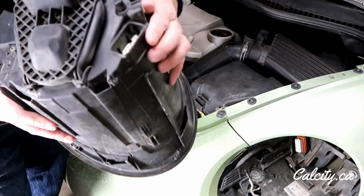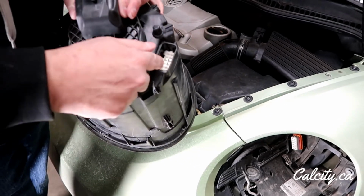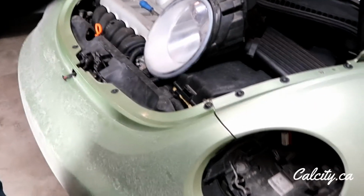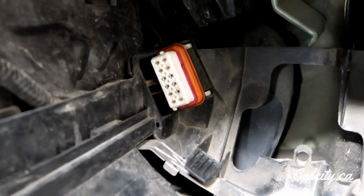The socket I was talking about, with the orange grommet, plugs into this 5-pin connector right here, and the connector itself is supposed to be stationary in the back of the headlight bucket, which is right here. This piece here, on mine you can see it sits in there kind of loose, so it doesn't make a great connection. So I'll probably cut this off and put a piece of foam in the back to keep pressure forward onto that plug-in, because that orange grommet around that plug should actually be almost invisible in the headlight bucket itself.